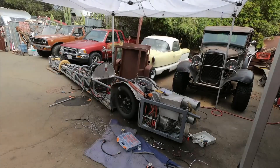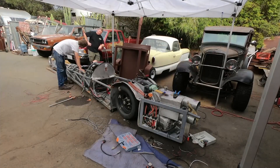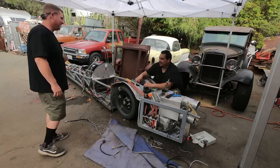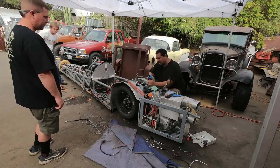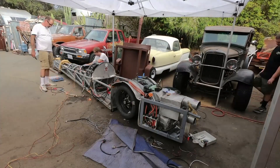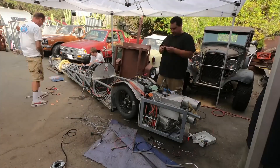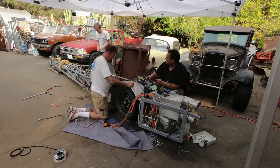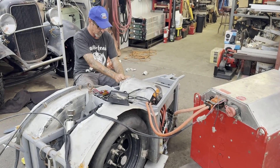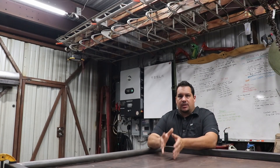It only took us a little bit more than a weekend to completely rewire the low-voltage side of the car. We put in a normal fuse block and just two relays — that's all that is running that car now. After that, we were able to turn the car on and get it basically talking to the inverter. There were some further 12-volt issues with power routing, so we were popping a few fuses. I retraced everything, found the issues — just dumb placement stuff that happens during a total harness rebuild — and got that sorted. Got the inverter talking to the computer.